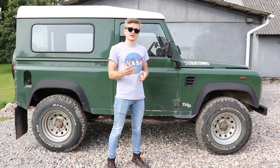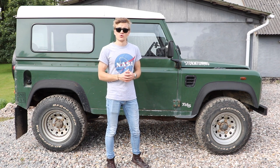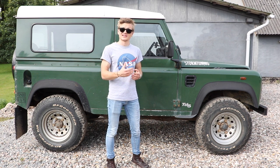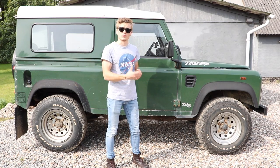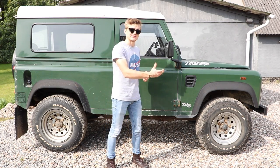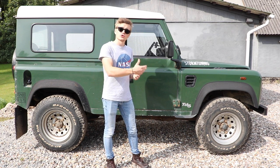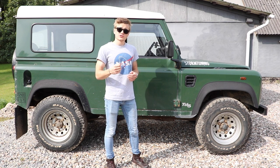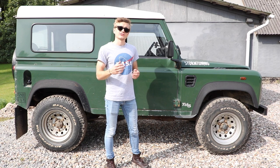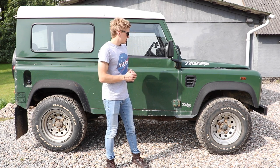This can also be evidenced in the fact that the car has two oil filters — the main one like any normal road car, and a centrifugal one so that the car can go longer periods without being serviced if necessary. But if you're someone like me who is going to service the car regularly, give it good quality diesel, and repair it properly, we can boost up the power quite a bit and still know we're happily within the design capability.